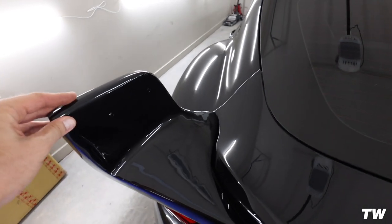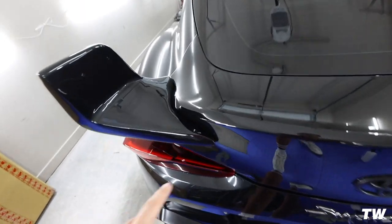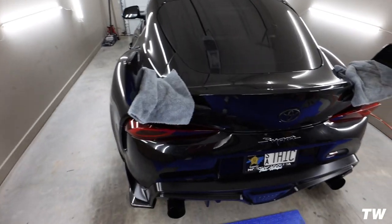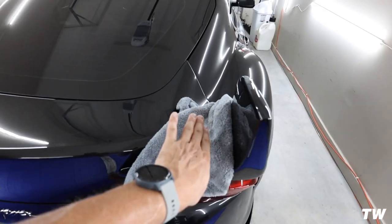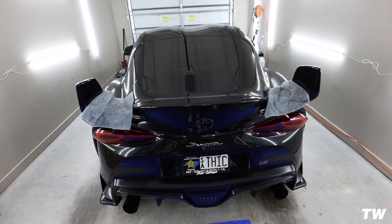Use that foam — it's going to be a big deal. Once we actually tighten the bolts down, all of that is going to compress — ain't no water getting in there. Now we're going to mount the top part. Pro tip: if you're doing this alone, throw a couple of rags right there in case the wing falls while you're putting it on. I like to put one side in, then put one bolt in, then lift it up, put the other one in, and go from there — that way you're protecting all your newly painted stuff.